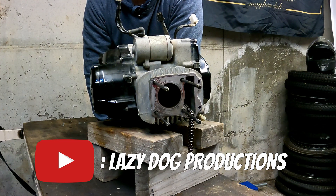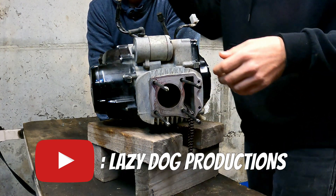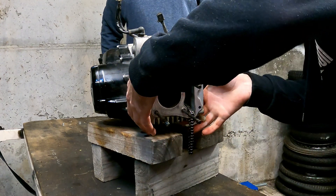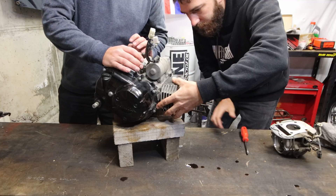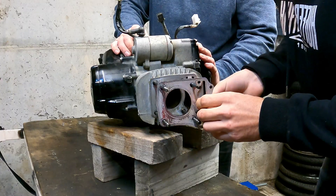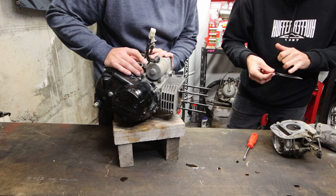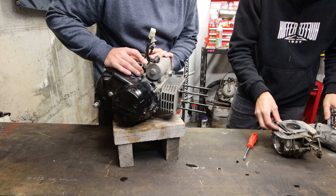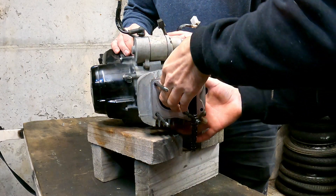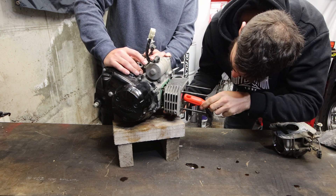There's an old chap — I'll put his YouTube username here — he lives in Chiang Mai in Thailand and he got a CT125 and went and got a 143 kit installed by one of the local shops. It all went well and didn't blow up or do anything silly, but he only did the barrel and the piston, didn't put a new head on. There are thousands of people who do 186cc kits or whatever, but I wanted something somewhat reliable. The head gasket is designed to be used only once — it's got a little crush washer system that once it's torqued down, that's it.